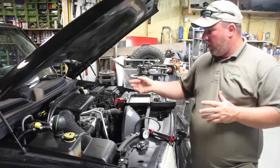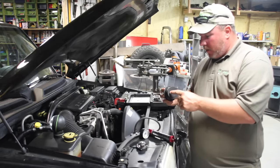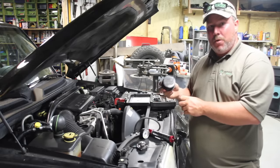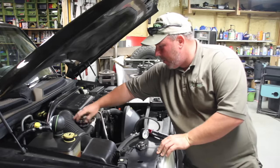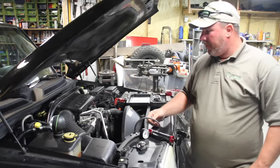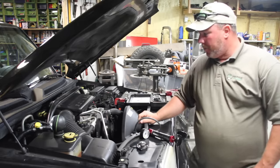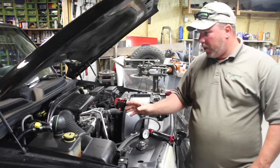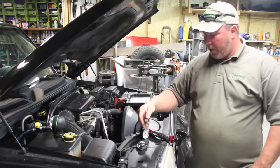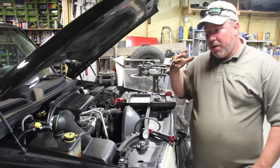If coolant is mixing with oil, you'd have contaminated oil. Pull your oil cap — a lot of times it'll have a white milky residue because moisture, as it gets hot, rises up. The bottom of the cap that should be black would look white. That's your first diagnostic symptom. Pulling the dipstick and seeing white milky oil would be catastrophic — you'd never want to see that, but it does happen. Similarly, if coolant was pumping into the cylinders, you could pull your spark plugs. If there's coolant in a cylinder, one of those spark plugs will change color — if you have green coolant, the spark plug will have a green tinge on the end, which is a surprisingly reliable indicator. That would indicate catastrophic failure.